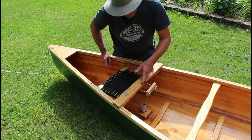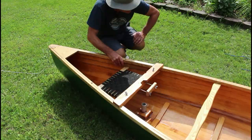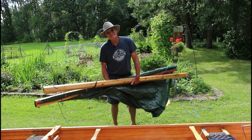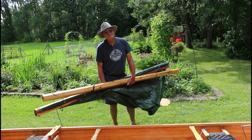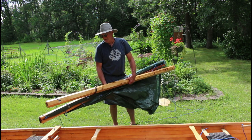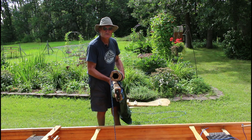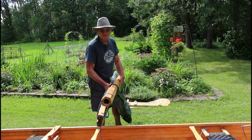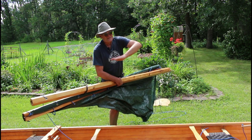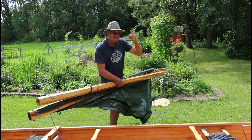I notched out a portion of the hexagon out of the wood, because I built my mast as a hexagon — I'll show you that next. A person certainly doesn't need anything terribly elaborate to make a mast for a sailing canoe; you can just go buy a closet rod. But I cut inch-and-a-half by half-inch strips of white cedar, beveled each of them on the table saw at 30 degrees, then laid them out with tape underneath, epoxied all the joints, and rolled the thing up and taped it in several places to act as a clamp.